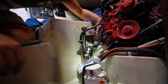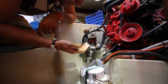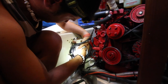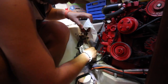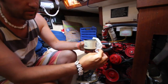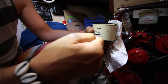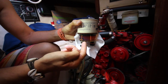The design of this thing is terrible because when you open up the valve to let the drain open, it also leaks through the threads immediately, so it never quite works like it's supposed to. This is the fuel filter cartridge — and this is the bowl on the bottom that's supposed to catch any water as it flows through and separate it. The water is heavier than the fuel so it sinks to the bottom, and it also catches a few random little bits and pieces.